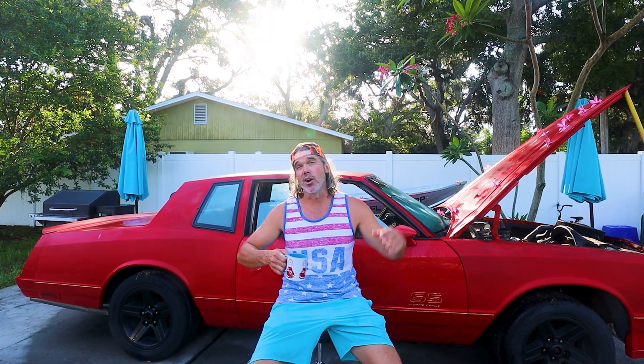There's going to be a mix of footage from me talking now and some file footage of me putting the last tune on this carburetor. When you first get your motor running and it's kind of radical and all over the place and it won't idle, the first thing you need to do is get your timing done. What matters most on these cars is the total timing — that's how many degrees after about 2,500 to 3,500 RPM. Pick a baseline, maybe 2,700 to 3,000 RPM, rev up to that point, and adjust your timing. Maybe start around 32 to 34 degrees.